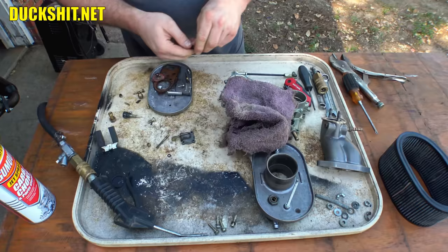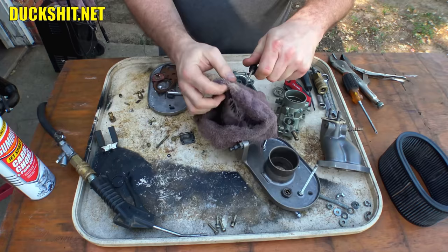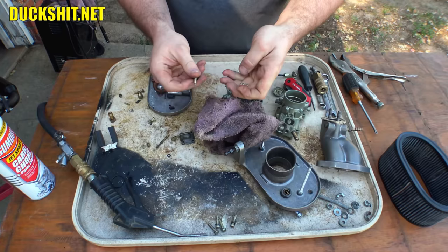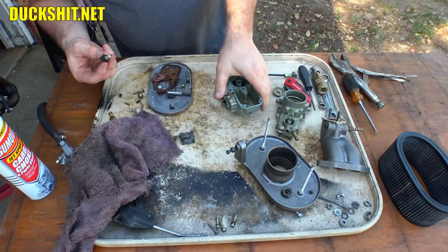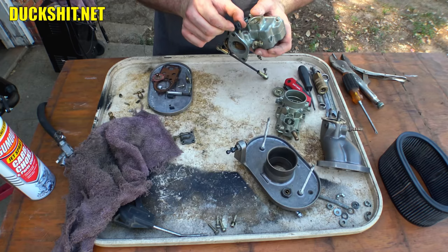This is just the needle for the low speed. These are interesting too. When you tune them for a 1600 engine, your low speed screw is only turned out about half a turn, maybe even just a quarter. And on Ruby, it's somewhere between. And this one goes, I believe, right in here. Tighten it all the way and then back off. Half a turn. That's it.